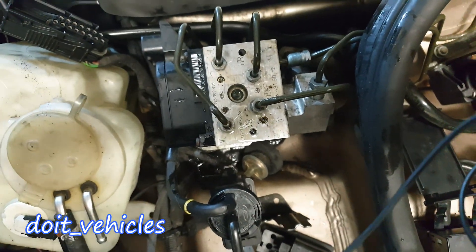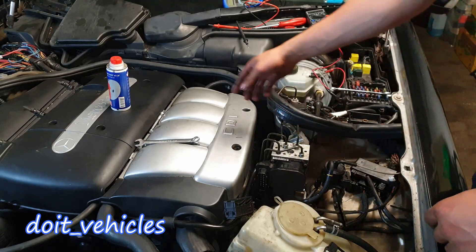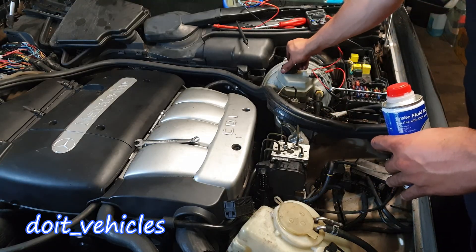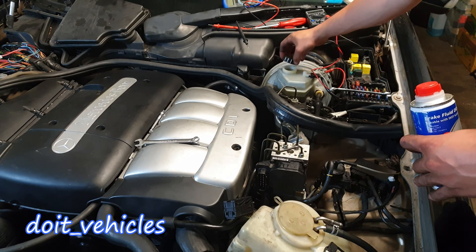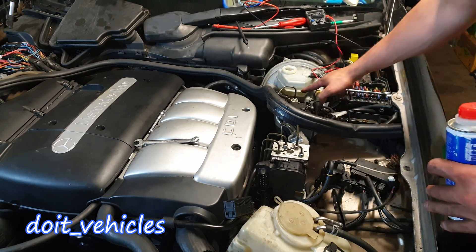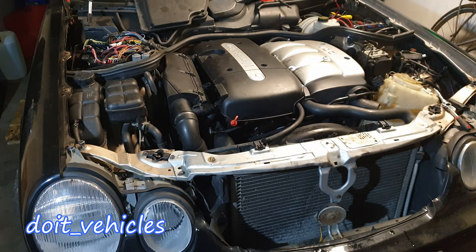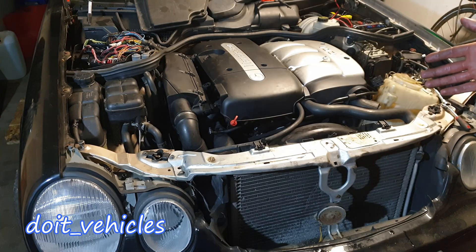You definitely don't want a leak, especially from a new pump. After you are done with the pump, make sure you add new brake fluid. Usually it will bleed by itself - you don't need to do much more than just adding the fluid until the reservoir is full. Alright, that was pretty much it. Thanks for watching. If you're new to this channel and you like this video give it a thumbs up and don't forget to subscribe if you want to see more videos. Hopefully I can invest in more equipment to show you a lot more - stay tuned and I'll see you soon.